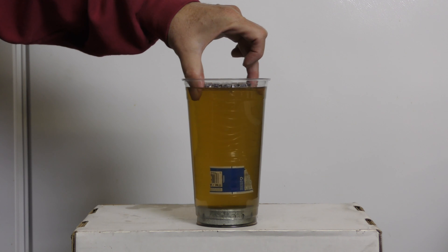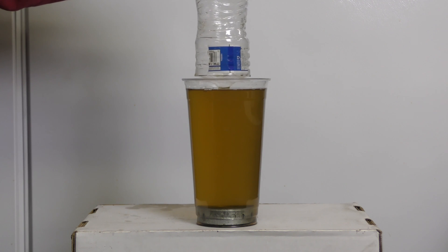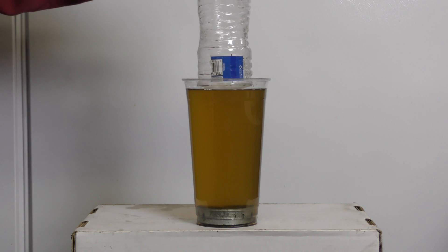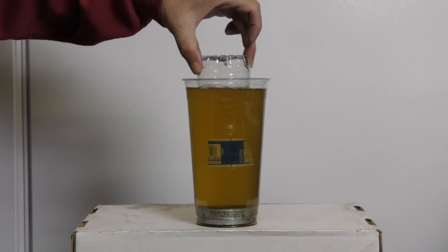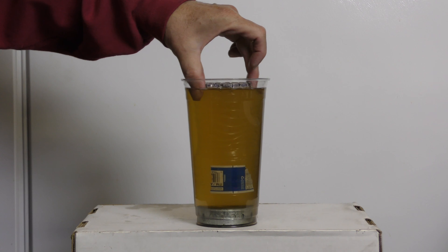This is hydrostatic lock, or hydro locking, where you've filled up all the space with fluid and still you could go further, but you don't. You'll see Dave push on one of these bikes that has hydro lock, and before he can get even very far through the stroke — much less close to bottom-out — the fork gets down, hits that fluid level because there's too much in there, and stops. It won't compress anymore because all the air gap is gone.